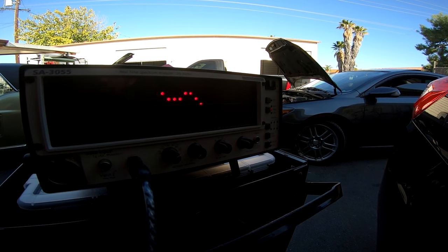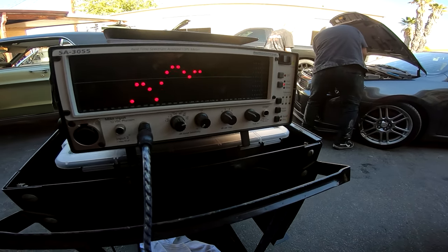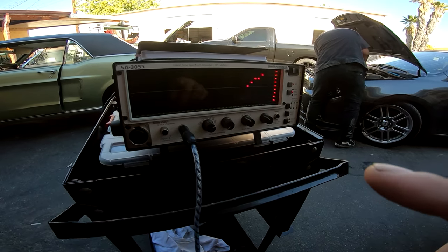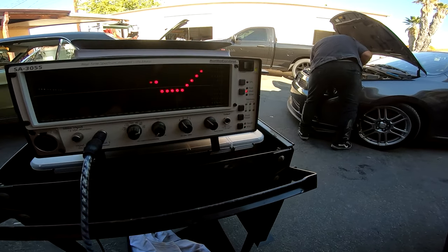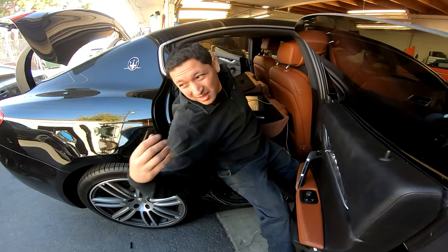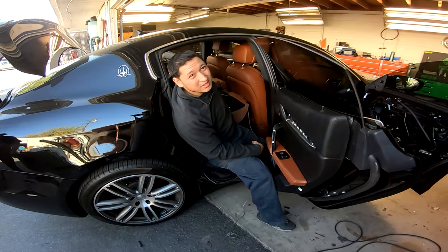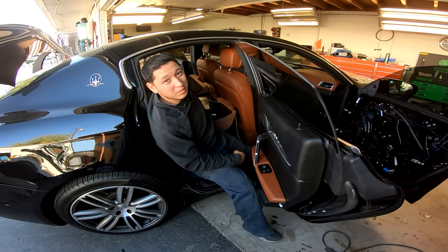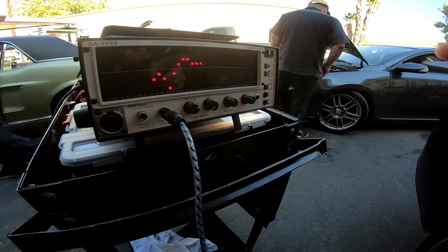Let's go ahead and see what the factory radio can produce by hooking up an RTA and check out the sound meters. We're seeing the rear channels right now as the frequencies are playing. We can see it rolls off at 315Hz so all bass is cut off the speaker. It starts at 300, goes up, then falls down at 4kHz, and then goes back up at 19kHz — that's way too screaming, way too screaming.